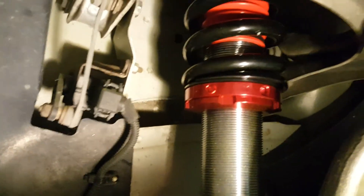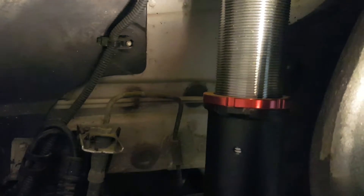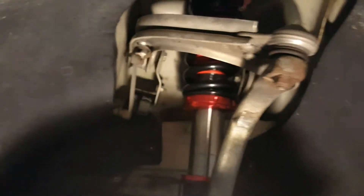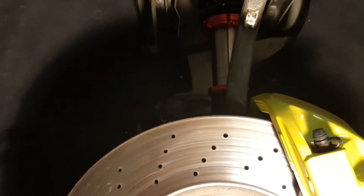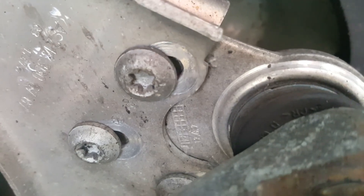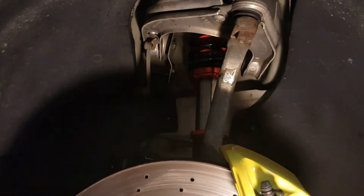The coilovers are now installed — here's what it looks like. I've also painted the brake calipers yellow. After installing coilovers, you'll need to raise or lower the car a few times to get the height adjustment right. The top adjuster controls spring preload — increasing preload also raises the car. The bottom adjuster increases the overall length of the coilover. Height adjustment should primarily be done with the bottom one; the top one controls droop extension — how much the wheel lowers when the car is lifted. I've left the damper adjustment at the softest setting for now.